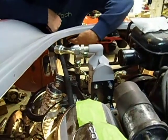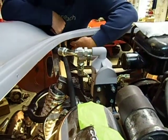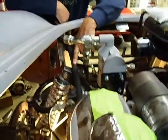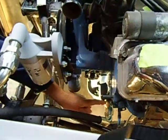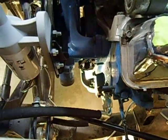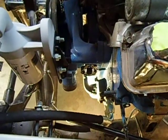Here we are with the third and final line. It's gone through the aluminum panel in the nose, through the bottom of the slot or the bottom hole, up over the top of our shock mount, and inside the inner fender. We follow that through to the 90-degree fitting on the other end. The 90 screws to a straight adapter, and finally the cooled oil goes back into the motor.